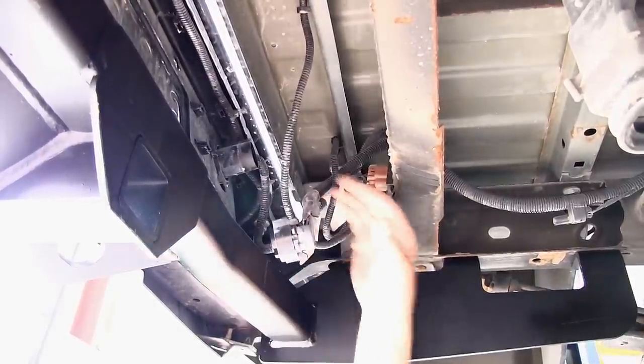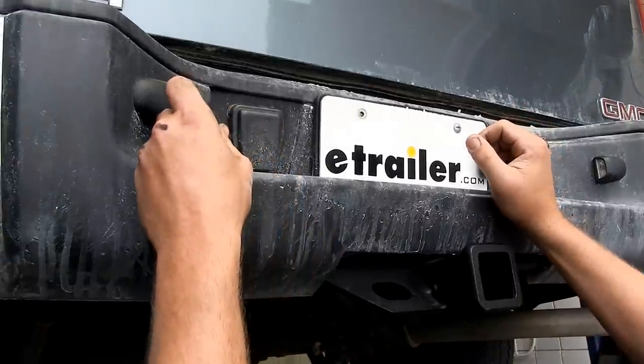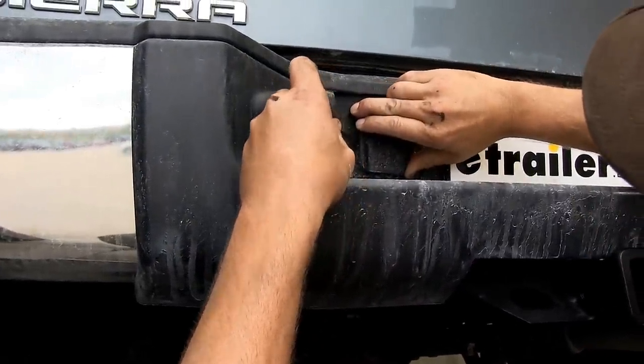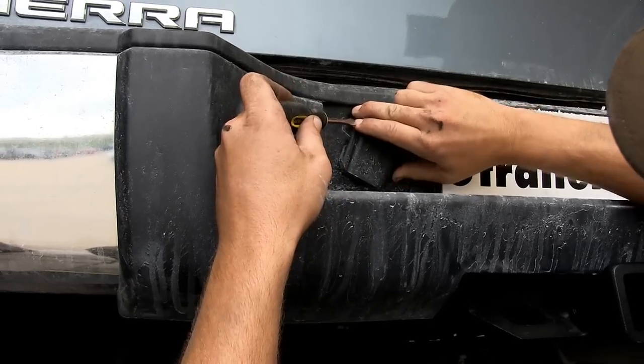You'll see here is the lock. Now that we've got it removed, we can go ahead and take the knockout out of the bumper. To remove the knockout out of the bumper, first we press on the locking tab and then rotate it to remove.